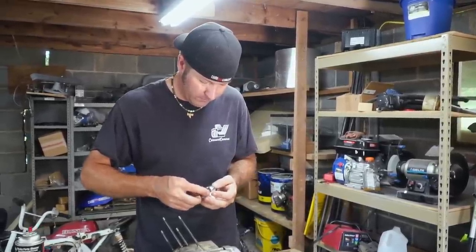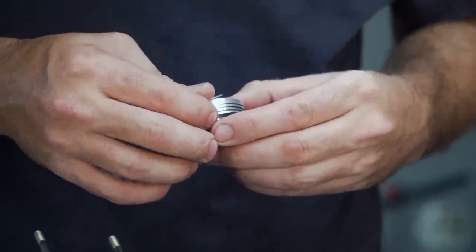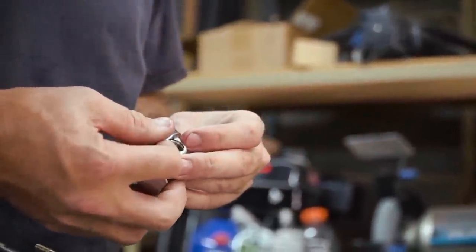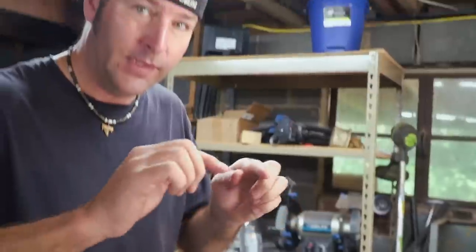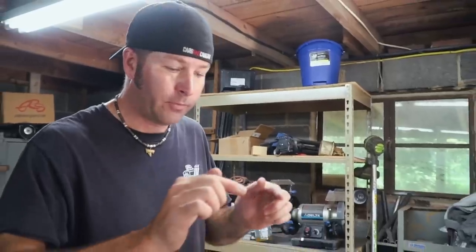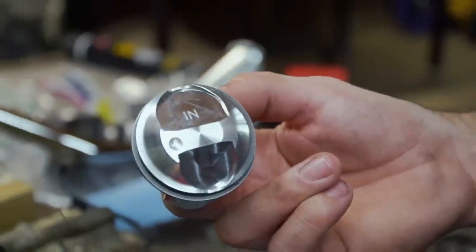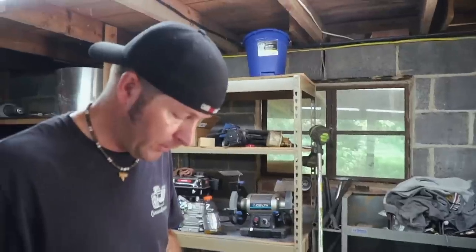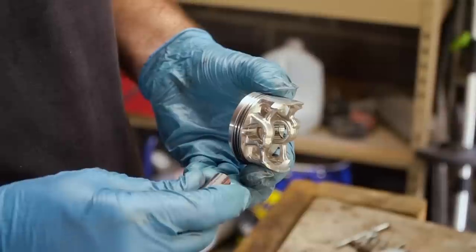Installing the rings — got to be careful, the rings are usually sharp enough to cut you. It says R on both rings. The top ring is actually rounded on the sealing surface on the outside, and the bottom ring looks perfectly square but they're apparently ramped. I've got to figure out which way this piston goes — intake is on top, exhaust is on the bottom. Bingo.